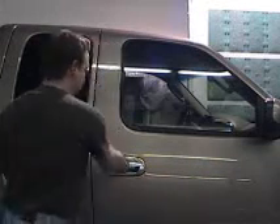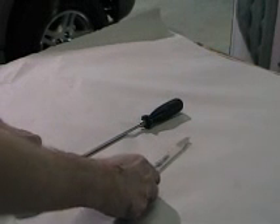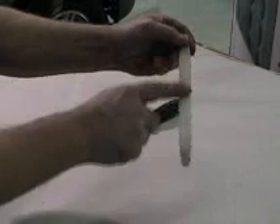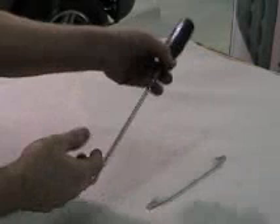In this demonstration, we're removing the inner door trim of a Ford F-150 from 1997 to 2003 with electric windows. It's a fairly easy process, removing the trim panel. There are a few clip components that we have to remove first before we get to the actual screws. The tools for today's removal will be the fiber stick — it's soft plastic and easy to pry underneath the trims so it doesn't break or mar the plastic — and a standard Phillips screwdriver.